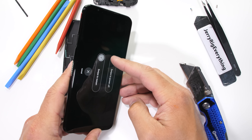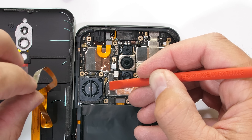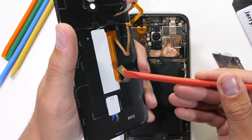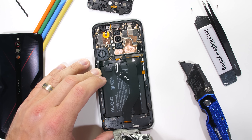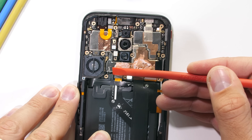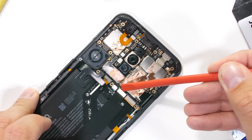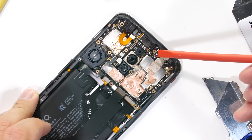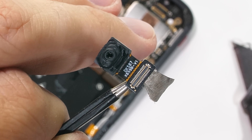First I've got to turn the phone off and remove the long rear LED ribbon cable for the RGBs. The LEDs just shine into the white plastic for that glow effect. The rest of this phone is kind of an unorganized mess. The battery actually has two connectors — I assume one is to power the fan and the other is for the phone, but that's just a guess. I'll pop off the additional extension ribbons and the screen ribbon cable just like little Legos, then unclip the headphone jack and front-facing camera, which is an 8-megapixel unit that can film in 1080p.